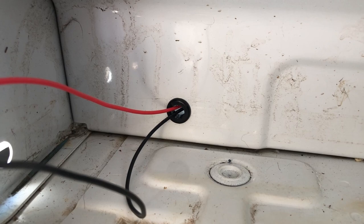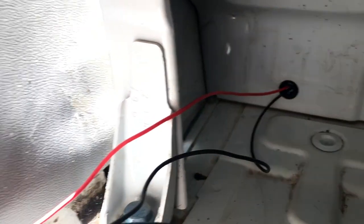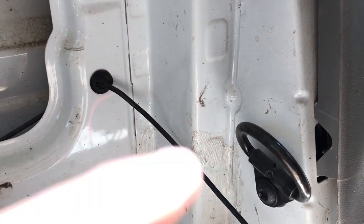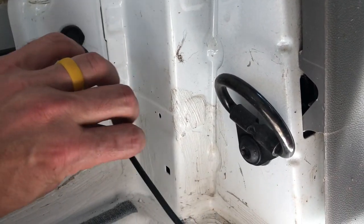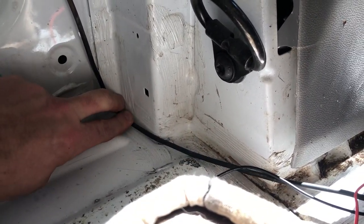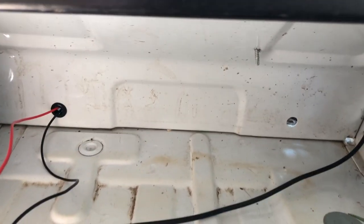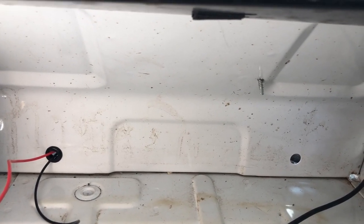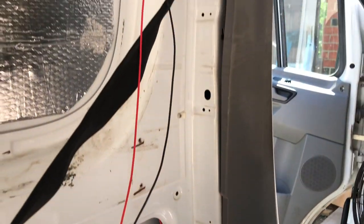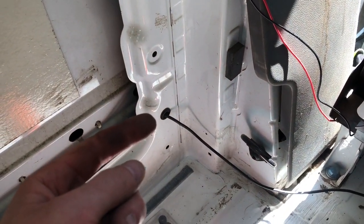The fan is hooked up and working. I was going to use a grommet in one of the pre-drilled factory holes — that's where I'll run my wires through for right now. Originally when my dad had somebody install the backup camera they ran the wire through here, so for now until I get ready to do my siding I'm just going to run it right here. This doesn't need to be final because most likely I'm going to get some longer four-gauge wire and run all my fuse boxes underneath and put the inverter charger down there — a little refactoring that's going to have to happen. Finally got it fished up through there, and then I realized I hadn't run it through the grommet.